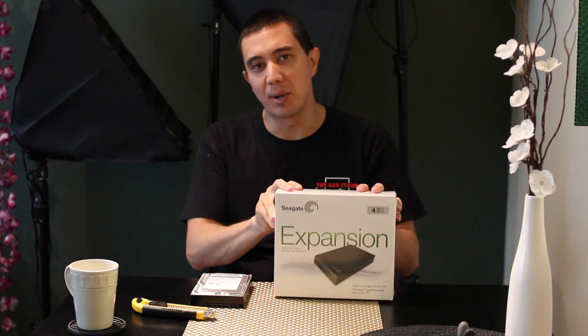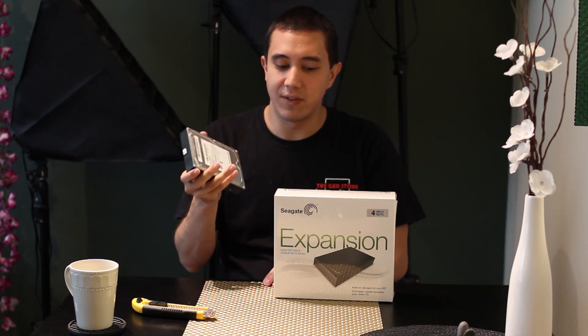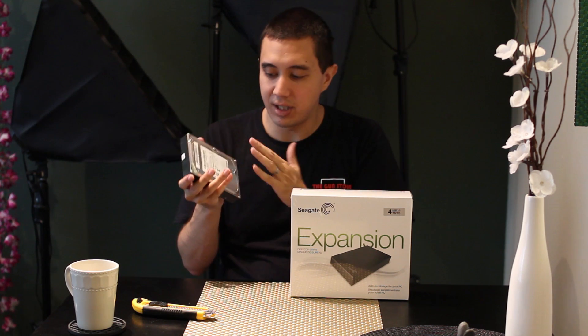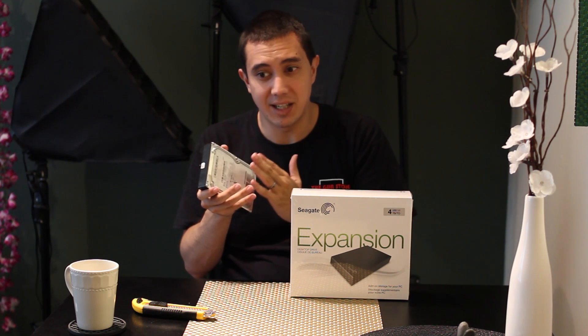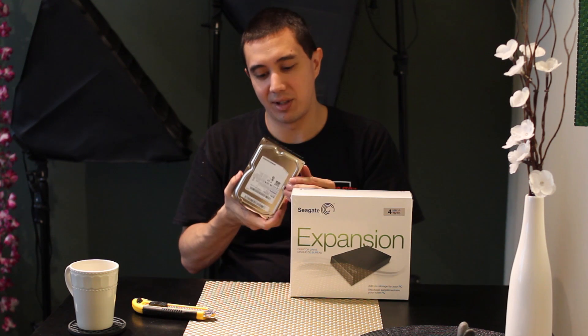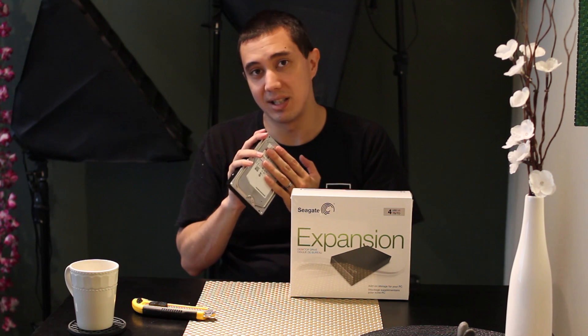Now, that's not a completely amazing proposition with bulk storage drives these days. But what has been evident in the last few years, and especially now, is that buying OEM 3.5 inch drives is significantly more expensive on average than buying these external drives. The reason behind that is quite frankly, what is the market for a 3.5 inch drive like this? The only thing you can put these into is typically a desktop computer, and a lot of people are just getting by on laptops these days. Even desktop computers tend to use laptop parts, or like iMacs, using 2.5 inch or 1.8 inch laptop drives. So the number of things you're able to put one of these into has been dwindling, and the interest in large 3.5 inch OEM drives is getting lower and lower each year.